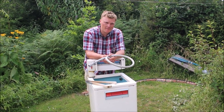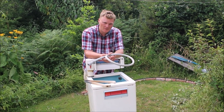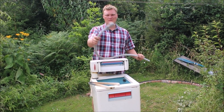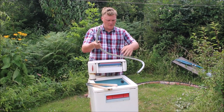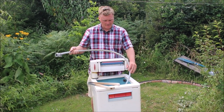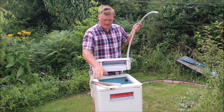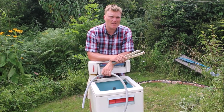One of the key differences about vintage washing machines like this is they are not plumbed into your main water line, which means you have to fill them yourself. That is what this pipe here is for — the end of this goes over your hot tap in your kitchen by your sink, and you'd simply fill it up with water from the main.